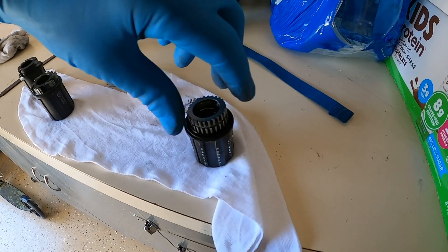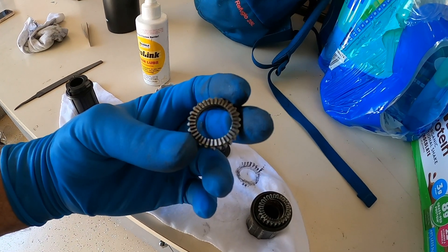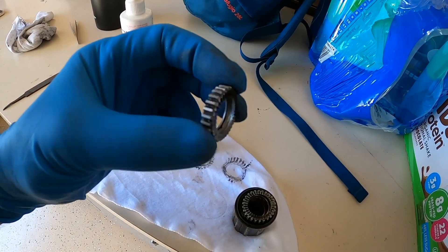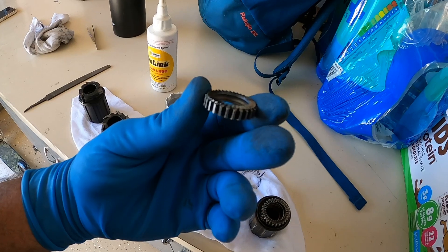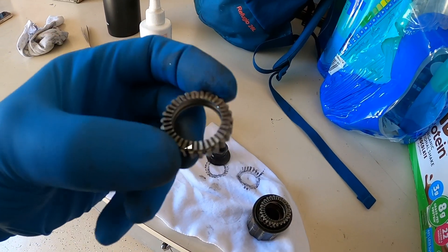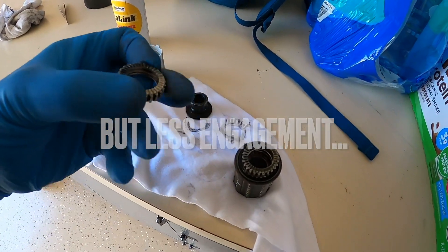You really can't demonstrate it — it's got to be going really fast. I believe this is only a 36-tooth. You can get up to a 60. You can double this, but the price does go up pretty high, about 90 bucks. The less teeth, I would think the more strength, especially on an e-bike — less teeth, bigger teeth, more strength. But this one has not failed me in over 800 miles.